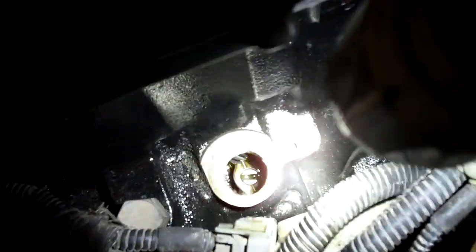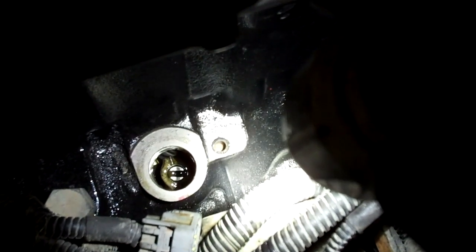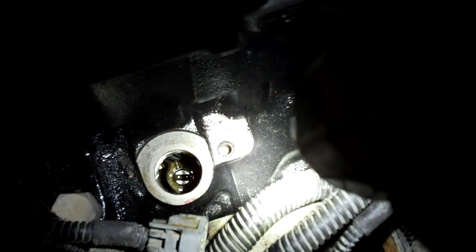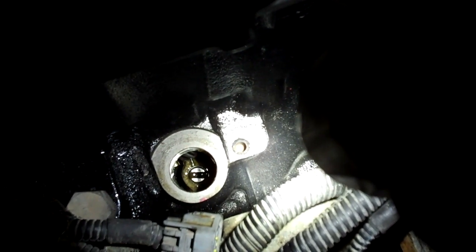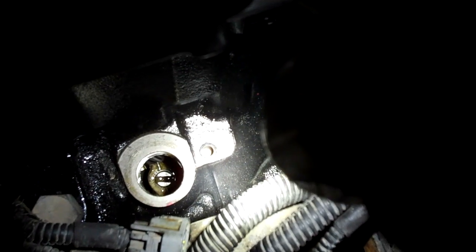Right here where it dropped. Anyway, you look down in there and you can see that it looks like a flathead screwdriver. Oh, I totally dropped that down in there, didn't I? That sucks. You just turn that and it primes your oil pump. And then you just put your camshaft position sensor back in, or your distributor, or whatever. It's time to go fishing with a magnet.